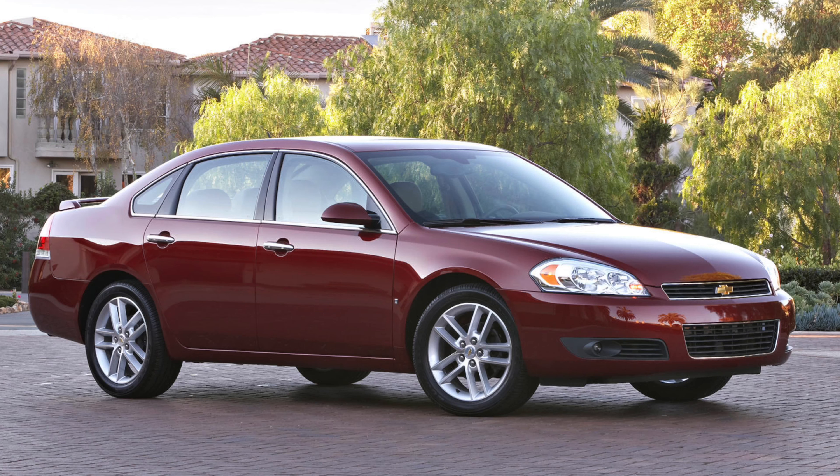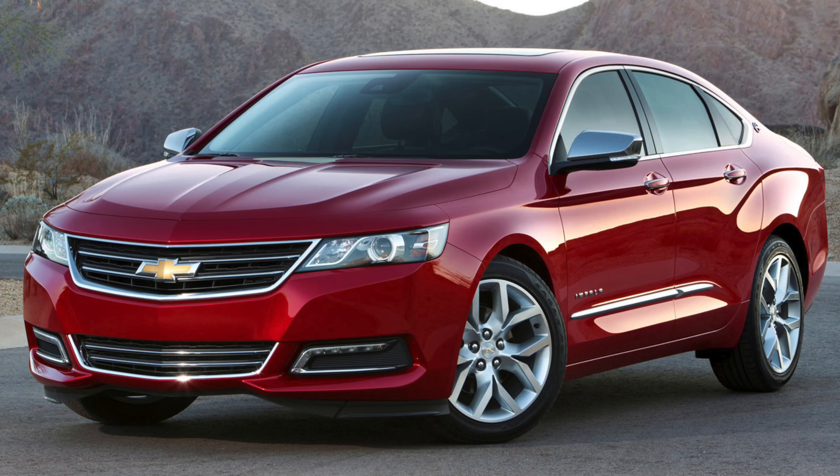Is there anything else to know about bolt patterns? Yes — bolt patterns can get complicated on cutoff years. For example, the Impala: 2013 was a 5x115, and in 2014 they changed it to 5x120. People get that confused all the time because that was a cutoff year. BMW transitioned around 2015-2016 to a 5x112, changing everything to match a Mercedes bolt pattern fitment — that messed up the whole wheel industry. So you've got to know your cutoff years.